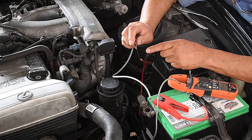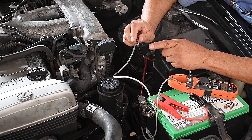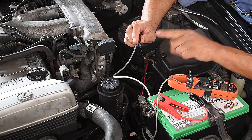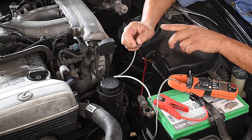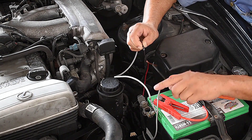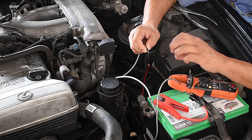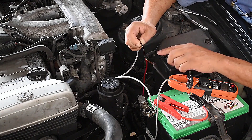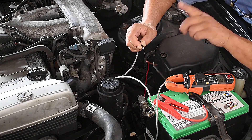Is it time to go to our favorite place? Let's go to the hood. One of the best assignments I've ever come up with — students were all required to do what I called the pelito setup. The pelito represents electrical protection from fire. It took quite a while for them to get up to this setup. First they had to make jumper wires, which helped them learn how to work with wires, solder, and crimps. They had to make pelitos, learn how to use a meter, and learn how to hook it up in series.